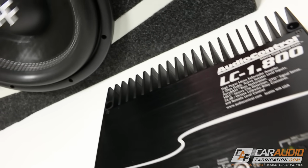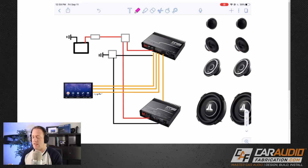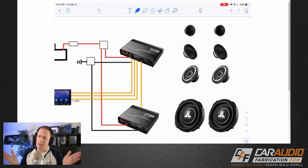That's just one small example of why it's worth drawing things out on these kind of projects and planning, because if you've done a bunch of 2 amplifier systems in the past, you would have thought, I only need these 3 RCA wires here. You may have forgotten about this 4th wire here to connect those 2 amplifier signals that is very critical. The final connections we need to draw out are those for our speakers.